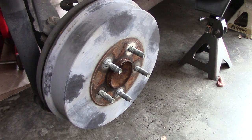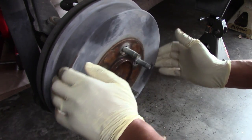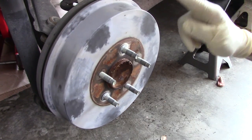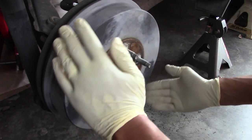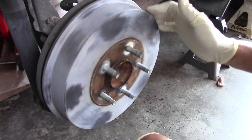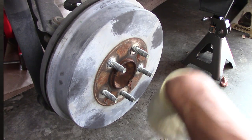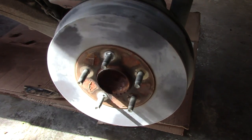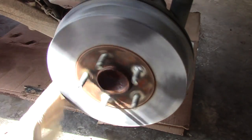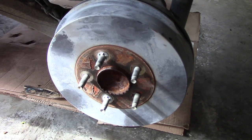The car is jacked up on both sides so I can spin the rear wheels freely. On this drum, if you listen carefully, you hear a little bit of drag in just one spot — and that is incorrect. You need to hear that little bit of drag every time you turn the drum. On the driver's side, same thing: the wheel stops in one place. So these shoes definitely need to be adjusted — it should be spinning freely with just a slight, consistent drag.